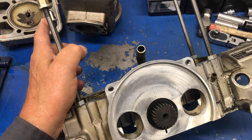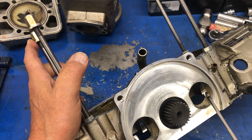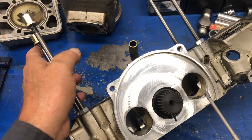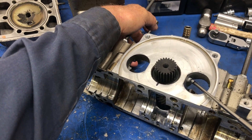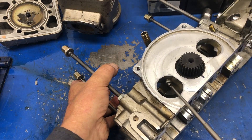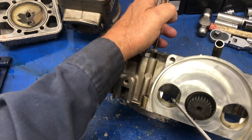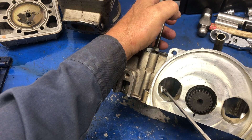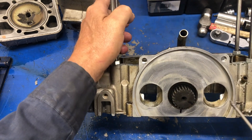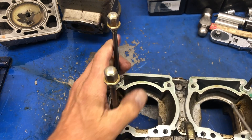It's so cool to actually see and visualize where the air-fuel mixture goes. This protrusion or deflector here is spotlessly clean, with deposits all around it — it's in there for a reason, redirecting the fuel charge. Same with this protrusion — nice and clean with deposits all around it. This one as well — nice and clean, you can see how clean and shiny it is, deposits all around it. These deflectors are extremely important and you can actually see what they do because I can see the rest of the fuel flow.